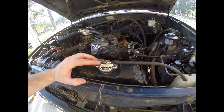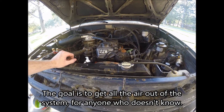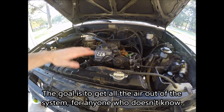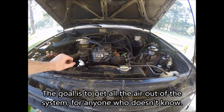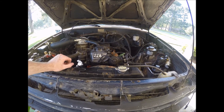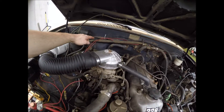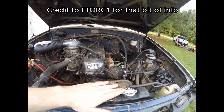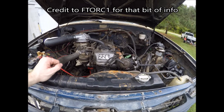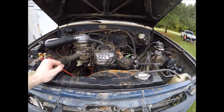Next step is going to be to fill it up and burp the radiator. What you need to do in order for that to work is have the cap be the highest point on the system — you just get the engine up to temp and open it, let it bubble out, keep adding it as you need to. You jack the front of your vehicle up because the heater core is right around here on the passenger side, which is roughly level with the cap. So you need to get the cap above that. That helps a lot with getting the air out of the system, having the cap be the highest part.